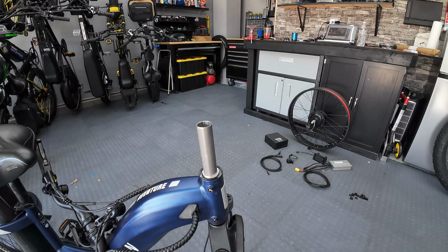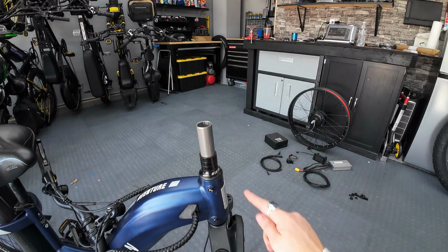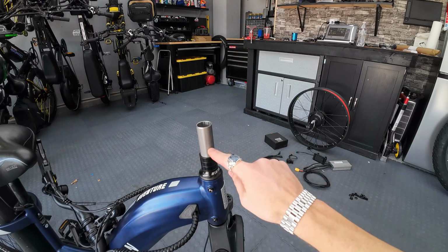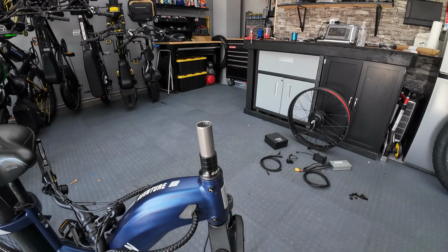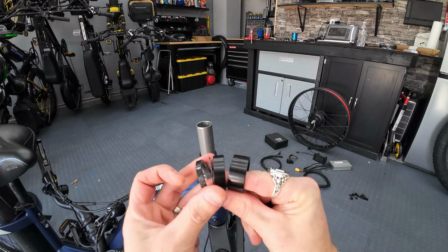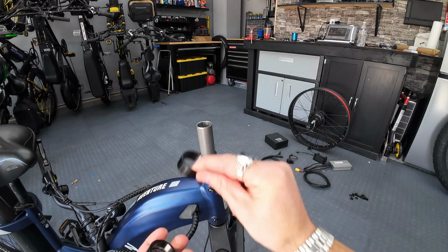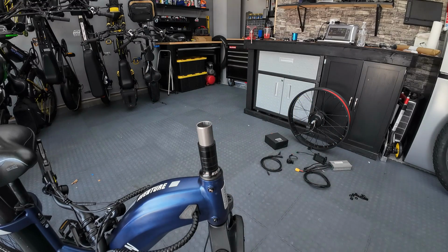And then you can see if I rebuild this now, and I put down all these Aventon pieces, all these spacers, and now if I put the handlebars on there, there's still going to be post sticking out the top. So this fork tube is a little bit longer than the Aventon one, but no big deal, because you can go on Amazon and for like 10 bucks you can get these extra spacers, of varying sizes, and you can just build this up to the height that you need and then put your handlebar on and you're done.